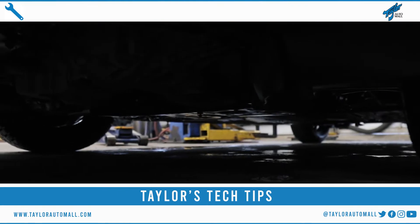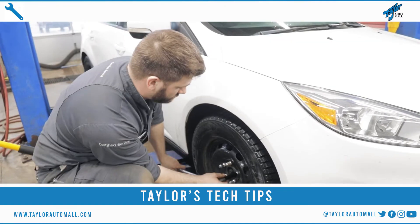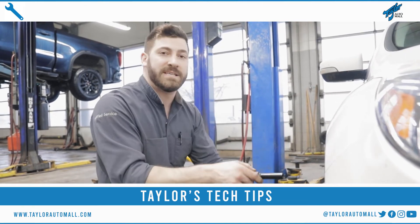When taking off your tires, what you want to do is leave the vehicle on the ground while you're cracking the nuts. What you want to do is crack each nut about half a turn before you lift it up in the air. Once it's up in the air your wheels are going to spin freely, so you won't be able to get good traction on it and every time you try to loosen it it'll just keep spinning.